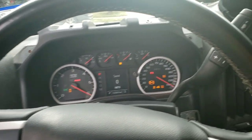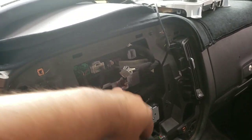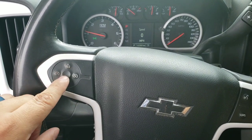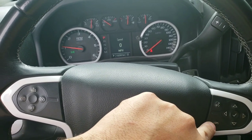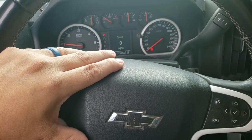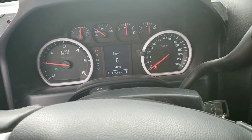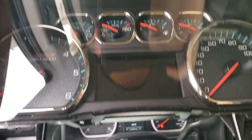I'm gonna be tapping into my radio wires since I have my harness wires that I ran from the cluster, so everything here is already plugged in and into the steering wheel. I don't have lights on this — they say after you do the gauge cluster upgrade it automatically works again, so we're gonna test that today. Hopefully I don't need a new clock spring because then I have to disassemble the whole steering wheel again. Right now I have 132,991 miles, and miles are not going to be displaying on this because it's not reprogrammed.